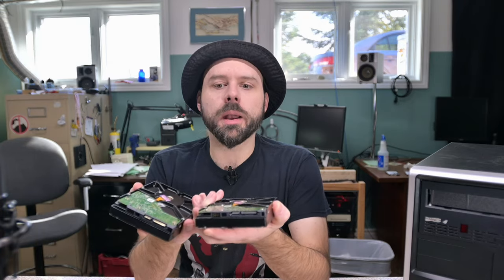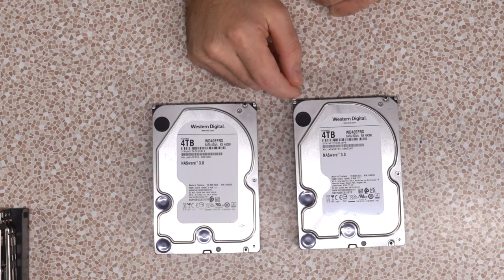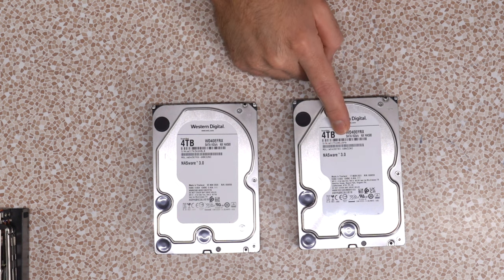And one might ask, why don't you just do RAID 1? Well, because these don't live in the computer. And for two, I don't want automatic backup. It has happened in the past where I messed something up on drive A, and then I'm like, oh boy, oh geez, okay, hold on here. And then I go over to drive B and pull that data off. If I do automatic synchronization on the fly, then whatever I screw up on drive A is going to be automatically screwed up on drive B, and that defeats half of the purpose of why I do these backups.